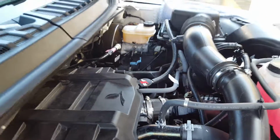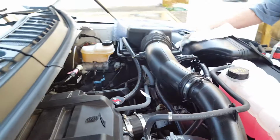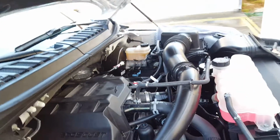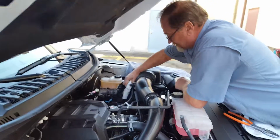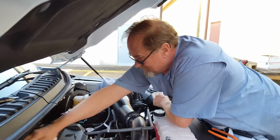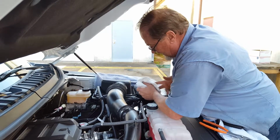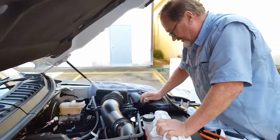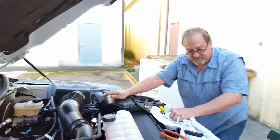travels around the camshafts, down through the oil return galleys, into the center of the crankcase, where it is flushing and making up for the foul, contaminant-laden vapors being sucked out the opposite side. I'm gonna wipe things down a little here, and now we're going to start it up and make sure we have no leaks, no check engine light, and everything is fine.